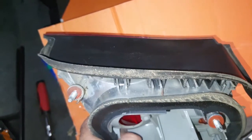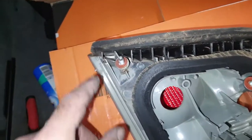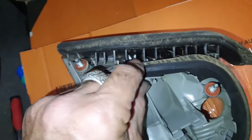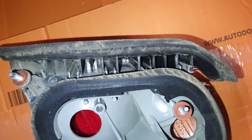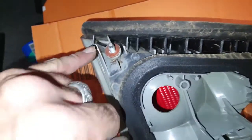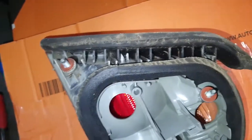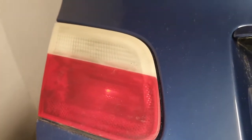This piece is just to stop water from getting inside the light. You can see the way it goes — it has little lips sitting in grooves all the way along. It's a real little bugger to remove, but get a screwdriver down there and just prise each side, doing a section at a time to get it off.